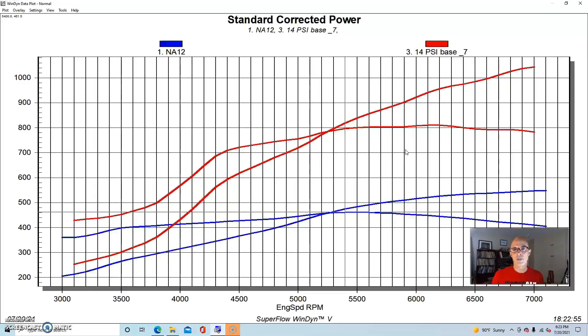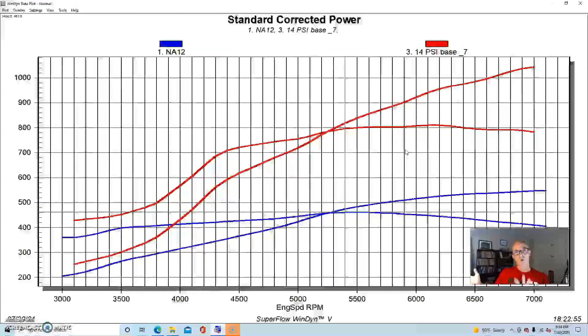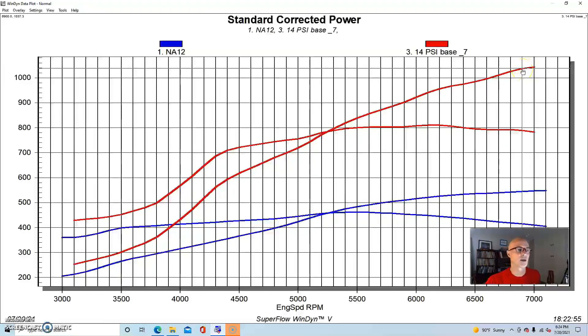We monitored charge temperature and all the relevant data. The way we normally run these turbo motors is using the dyno water supply — we have a 2,500-gallon cell that West Tech supplies water from. We just divert some of that water through the air-to-water intercooler. In this case it was about 78-degree water, going through the core and back into the tank. For the test, we hooked up a dedicated cell filled with ice water to supply both cores with ice water. That was the only change — no air-fuel, no timing, no boost adjustments. Boost was all controlled by a manual wastegate controller.